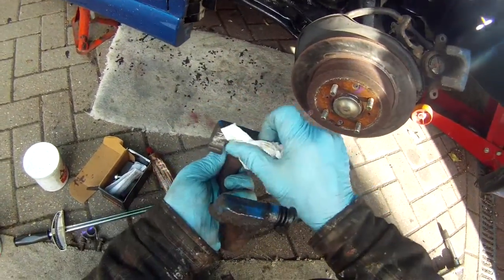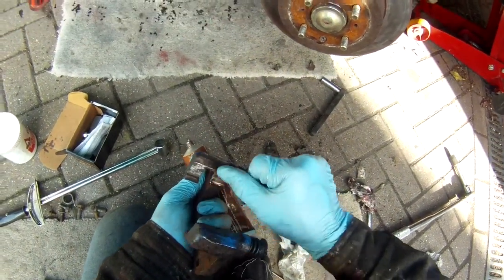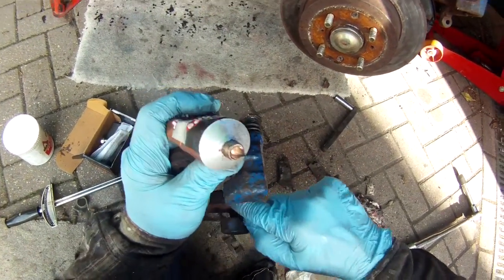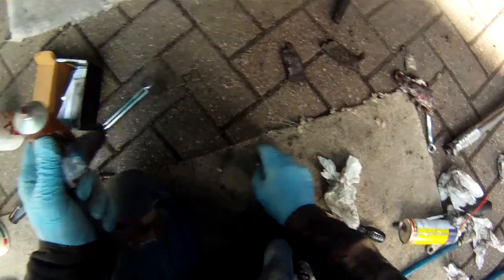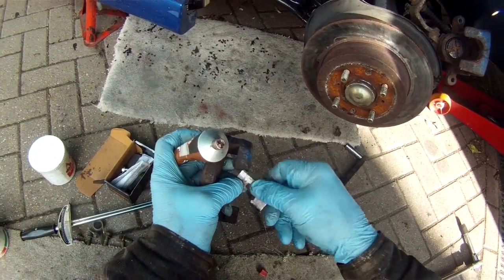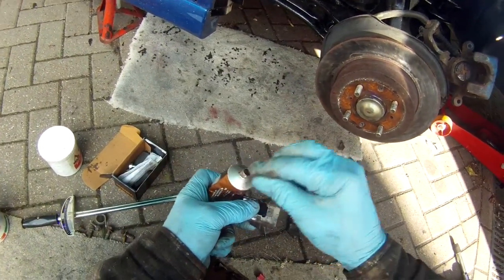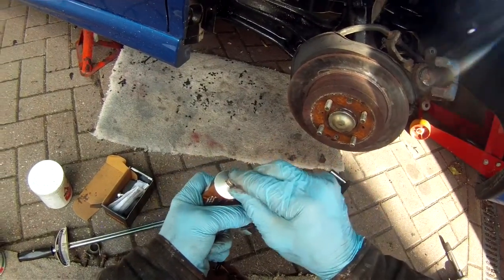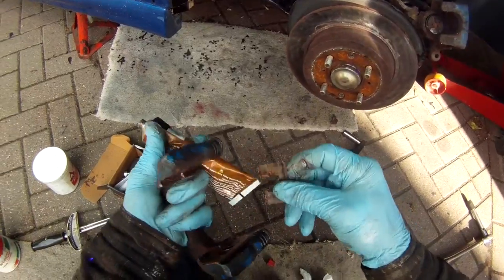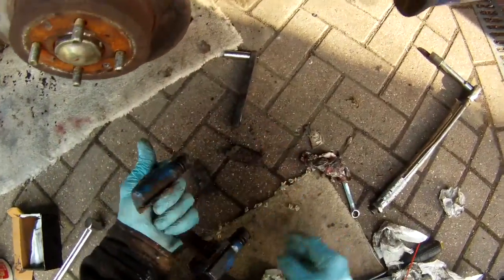The surface where the brake pads go is cleaned up. Put some copper grease on those surfaces — it not only stops it rusting but allows for easy movement of the brake pads. The factory clips go onto these areas so lubricate these up as well for the spring clips. Keep the grease well away from anywhere where the disc is going to be. Don't forget to remove any deposits and rust from these spring clips as well. Keep your hands clean.